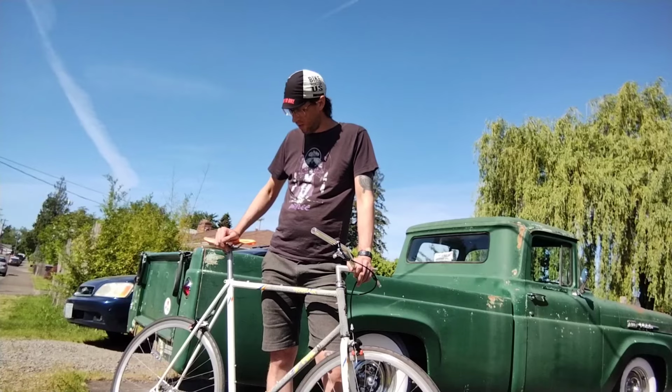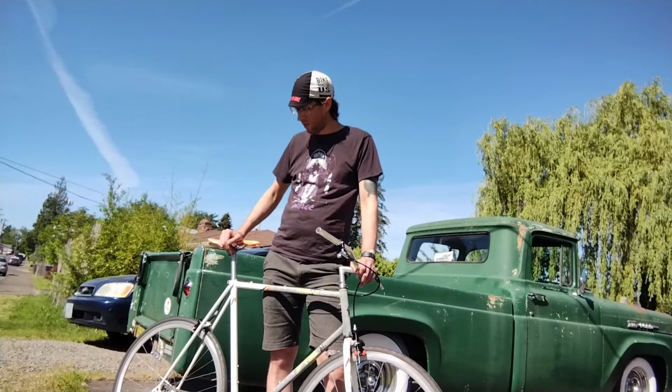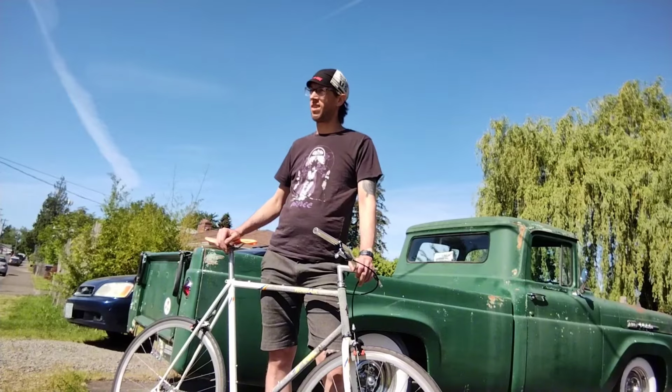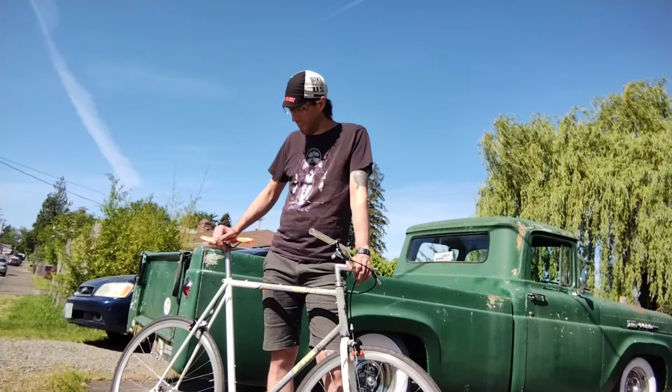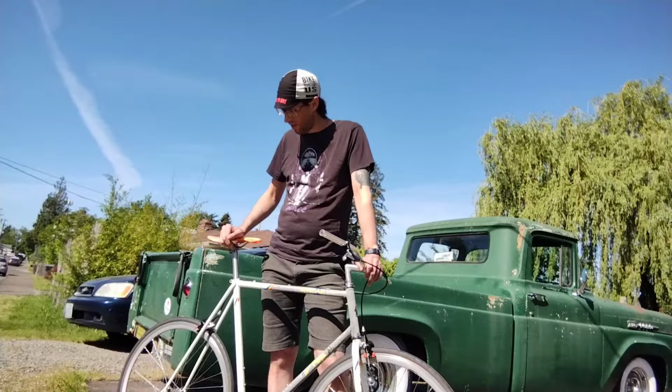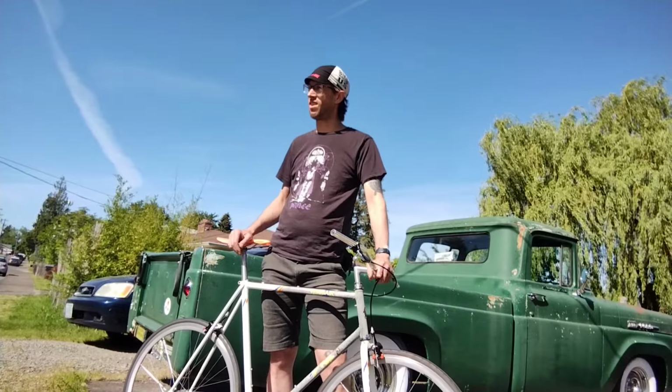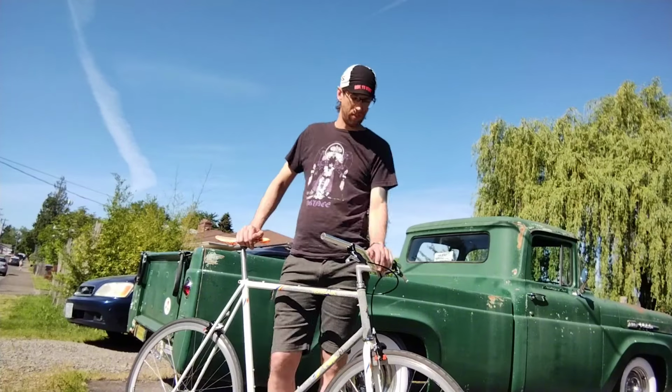Yeah, that's really bad. But it's stretched. You don't want to wreck that nice freewheel. So you got one nice part on there now. All of a sudden, you got all these chores. If it was a shitty chain or you get a shitty freewheel, it's like, who cares? Right. It's a single speed. You can ride those things till half those teeth are completely worn off, the other half broken off. You couldn't tell.